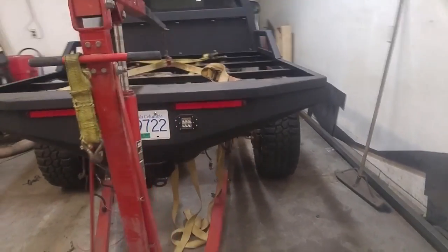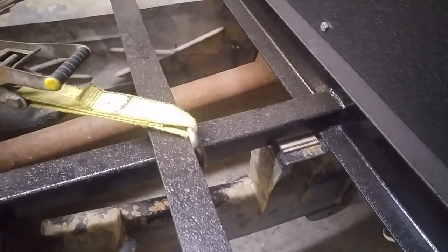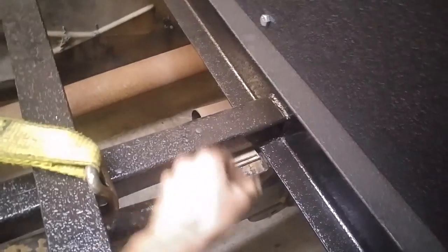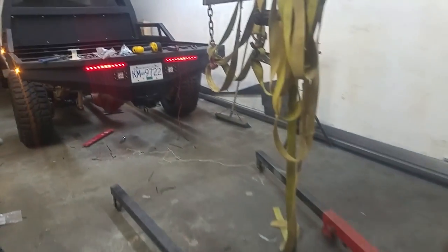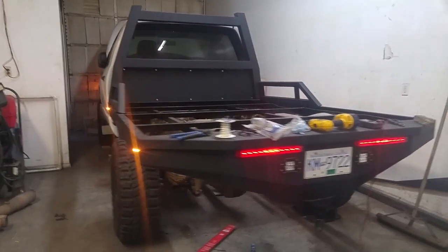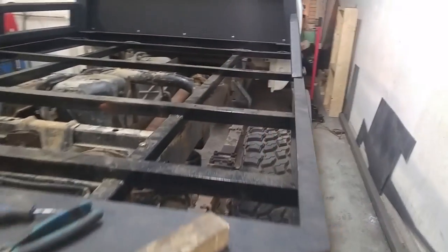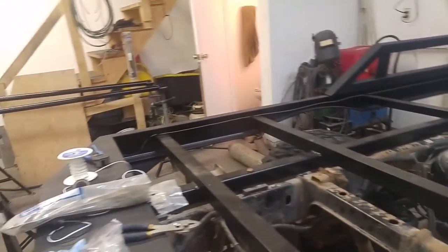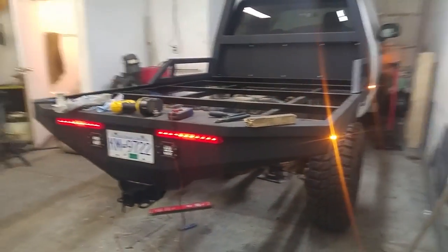Just getting this thing centered now and then I'll drill the bolt holes - one here, one here, one here, one there, and here. I'm just using bits of quarter inch plate as spacers so you can get all the height exactly perfect. Just getting the wiring figured out - well, not really figured out, just getting it done because it's pretty simple. I'm not a big fan of putting marker lights inside though, just for the sole reason that you've got to run so much wiring all the way around the whole deck just for a couple of orange lights. They look pretty cool though, I do admit.